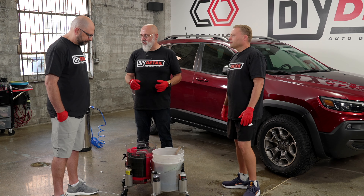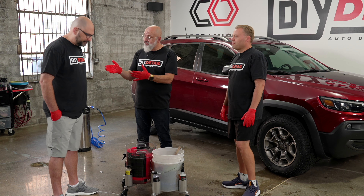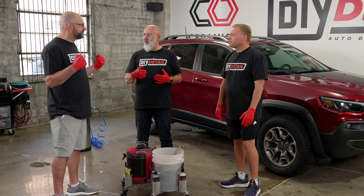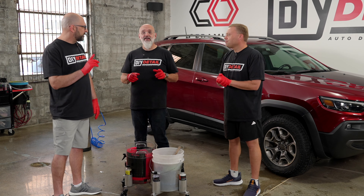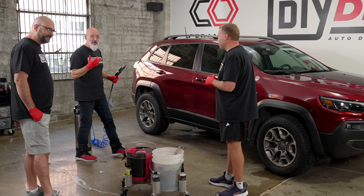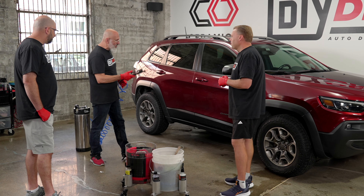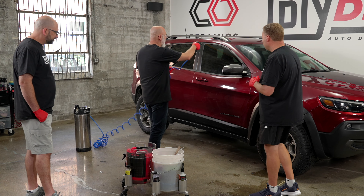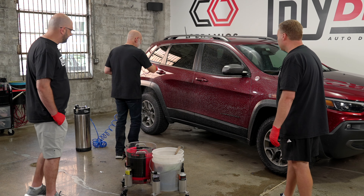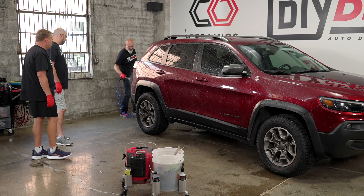I use a multi-media type process where I'm using four or five microfibers and then flipping them to always have a clean side. That way my bucket — the rinseless wash — I can cap it off and use it for other things, like my interior later on; nice clean bucket. Ivan is going to show us the science behind rinseless and how it pulls dirt out of the media, and ease your fears when you see the murky dirty water in the bucket — because that's not going back onto the car. You can use code CARSWITHKEEVE to save 10% at DIYDetail.com. Check the links below for anything in the video.